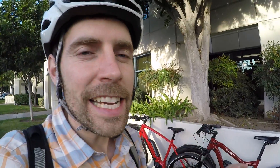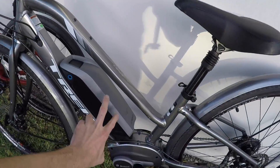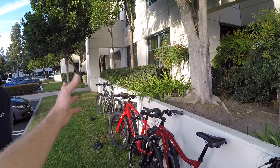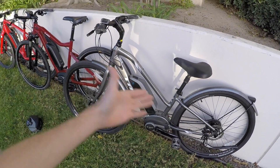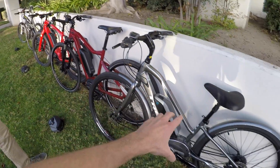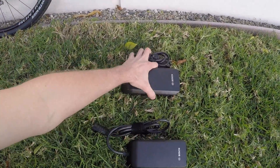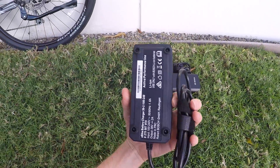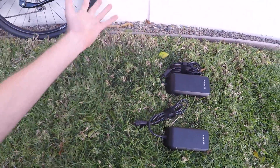Hopefully you're getting an idea for the differences between each motor. I also wanted to highlight that these batteries are interchangeable. If your girlfriend loves riding a mountain bike but you're just joining occasionally on weekends with an active line motor, you can swap batteries — even if she has the 500 watt-hour battery and you have the 400. Whether it's the rear rack batteries or the downtube batteries, they're interchangeable. Bosch also has two different chargers: a four-amp charger at 1.7 pounds for faster fill, and a compact two-amp charger that's lightweight. Both have the same plugs, so they're compatible with any Bosch battery.